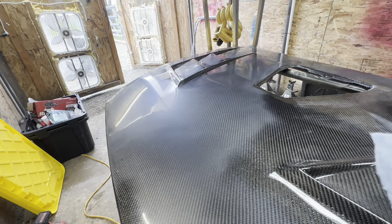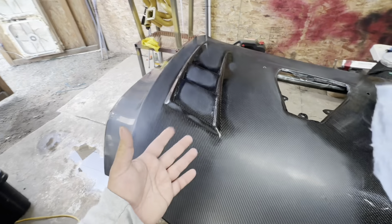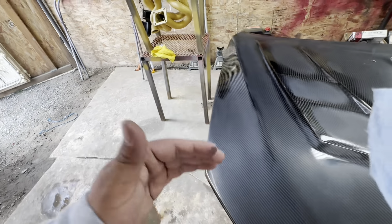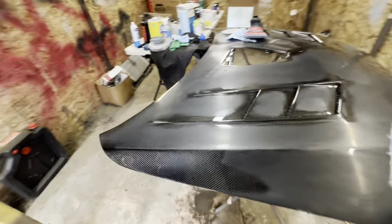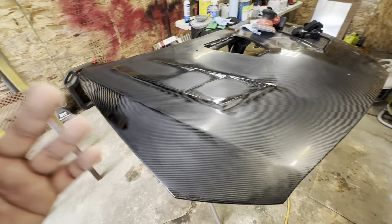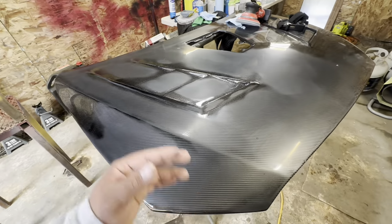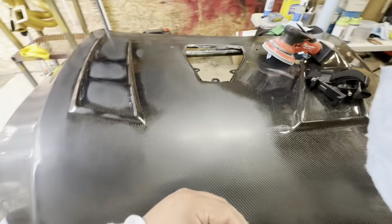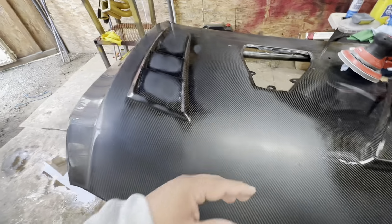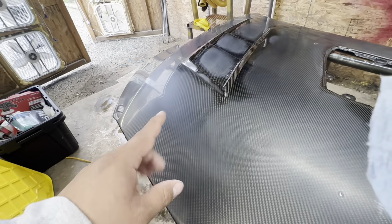And as y'all can see there, the shine is starting to come back, which is an awesome thing. Reason being is because every time you step up in a different grit, the shine comes back more and more. Rule of thumb that I like to do is at least 2 or 3 passes with each sandpaper. So if I do 2 with 2000, I'm going to do 2 or 3 with 3000. If I do that with the 3000, I'm going to do 2 or 3 with the 5000. I like to match it. That way you get rid of the previous sandpaper's sand scratches.